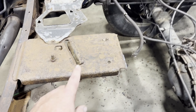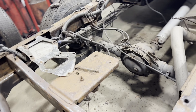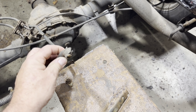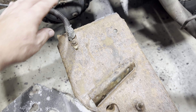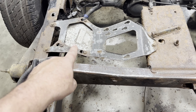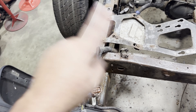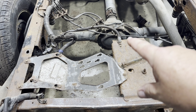Unfortunately, the spare tire usually catches the brunt of the problem — it makes the problem even worse and the whole cross member falls out. But we got that under control. Also, if you guys own Silverados like this, you see this wire right here? That's supposed to go right there. That is actually the ground for everything in the rear, including a portion of the fuel pump control module, as well as all the lighting and trailer lighting. It usually affects the driver's side rear light when that ground goes. But if you're having an issue with your lights, check that ground because it's most likely rotted.